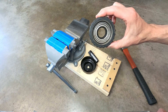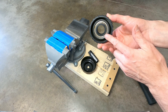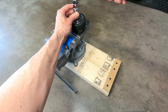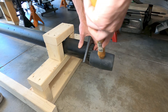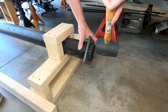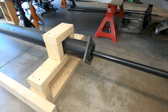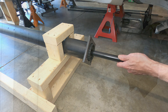Step 9: Once you're ready to begin the driveshaft installation, use a press or a plastic hammer and a 22mm or 15/16-inch socket to press out the bearing insert from one of the factory bearings. A larger socket or spacer placed below the bearing unit will support it and allow for the insert to be pressed out. After the insert is removed, tap the Porsche bearing unit into the engine side of the torque tube just far enough to hold it in place but with most of it still showing so that it can be easily removed later. This bearing unit will be used as a stop for the driveshaft from being pushed through the tube at too severe an angle, which could potentially damage the super bearing or move the first two from their positions.